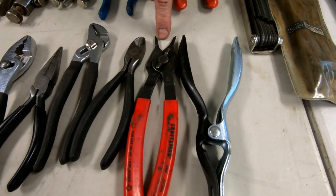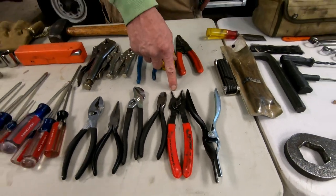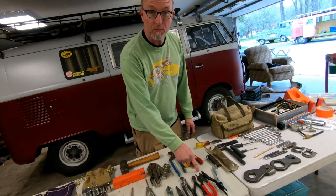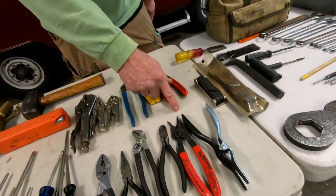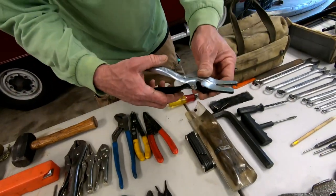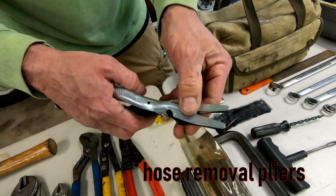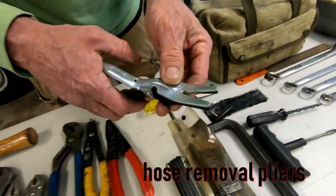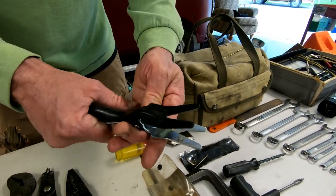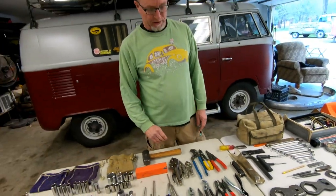These are a set of reversible snap ring pliers. I know it's a little far-fetched, but one time we were rescuing a single cab and we didn't have these with us — we needed them to pull off the axles. So now they're in there. This is our newest addition — it's a neat little deal. It's sometimes hard to get, but this actually helps you remove the fuel line hose from the fuel pump and the carburetor without jiggling it back and forth. You just put it in there and it pulls the hose right back. What a neat little thing — everybody got those as Christmas presents this year.